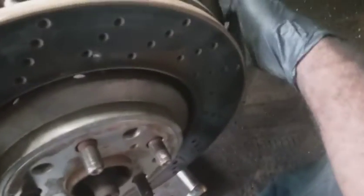So I want to see what happens if I can shimmy this on out. We'll see what happens. Hopefully. Okay, so I might need to just take this tie rod out. Let me turn the wheel to a different angle, and I might just have to take the tie rod out, and I'll have enough clearance to pull that lower arm out for the shock, strut, air shock, however you want to call it. Move it out, and I should be able to extract it.